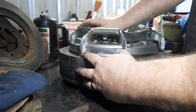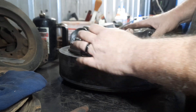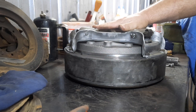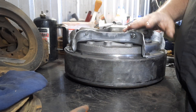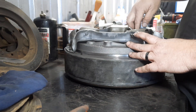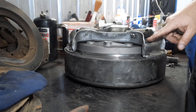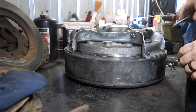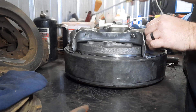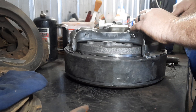These bolts are supposed to be torqued to 21 foot-pounds. I've also saved you the trouble of loosening these up, because sometimes they're sent generically set, and when you start to tighten them down the fingers will pull all the way down to the body inside and you can't get a proper torque. So you've got to loosen the adjusting bolts — the little spring clips are quite the booger to get off sometimes.